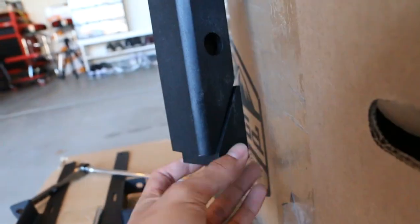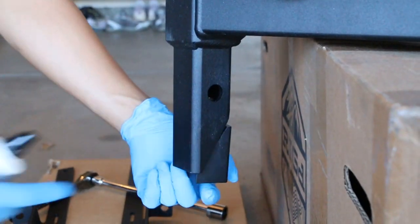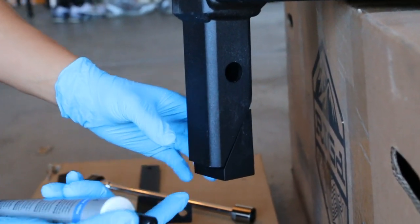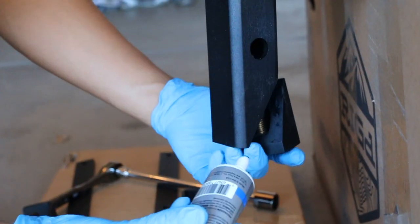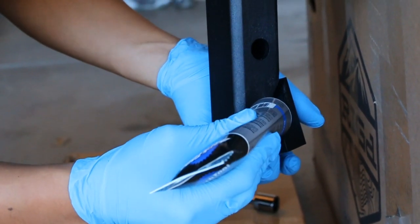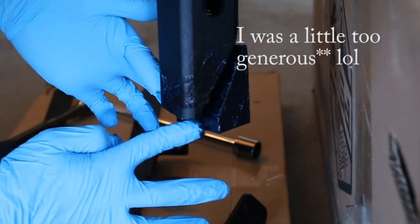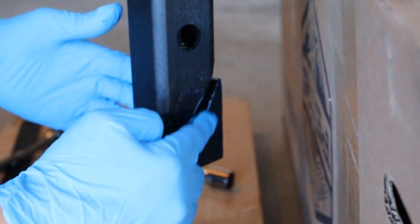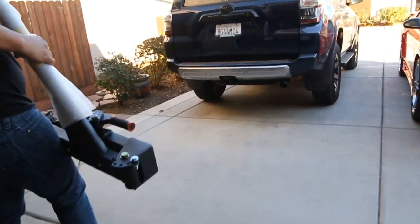You loosen that out — now you can see this kind of dangles here, and when it compresses in it makes this whole pipe skinnier so it'll fit into the hitch of the car. Next up, we're just going to grease up the wedge to prevent any metal-to-metal contact so that when you torque this down it's nice and tight and doesn't get caught on anything. I'm just using part tool grease. Make sure every metal surface and contact point is covered — you don't need too much on the outside. It's just to make sure it slides in nicely and can expand to the size of the actual hitch.